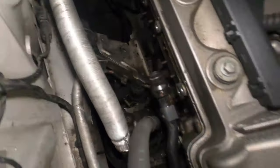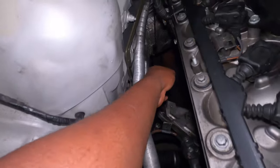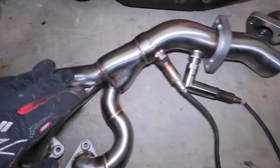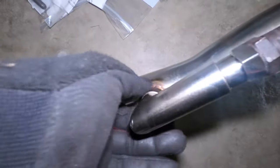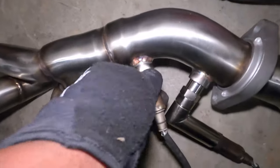Also, I might want to clean up a little bit in there because I see a little bit of oil residue — it's a good idea to do that. After you mount everything, you route all the oxygen sensor cables all the way up there, plug them to the specific spot, and mount everything back together. Once you install the oxygen sensor, it should look something like this, where you have the extender right here. The way the extender works is you put it here, tighten this end, and leave the other end loose for now because you'll need to adjust it while mounting. Once it's installed, tighten it up. Now it's time to go ahead and put this back into the car.